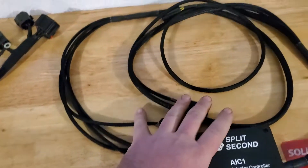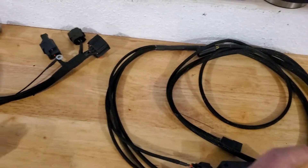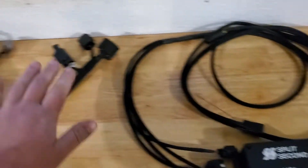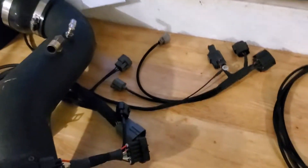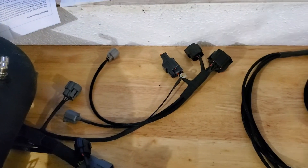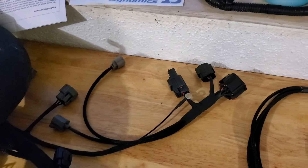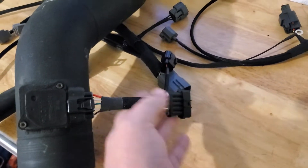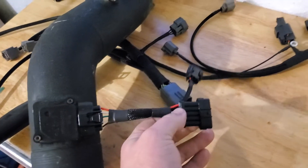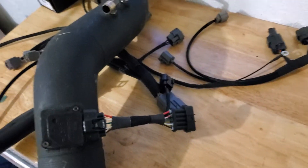This lazy boy will not work without his harness — it's only usable with his tuck harness. This makes it plug right into your car, and if you ever had to go back to stock you can just unplug everything — you didn't cut into any factory harnesses. It makes it super nice: you didn't cut into your MAF wiring signal, which is sensitive OEM wiring. He makes the harness so you can just unplug it and go back to OEM, no harm.